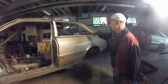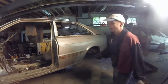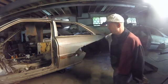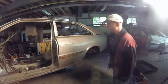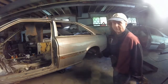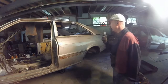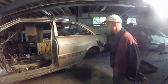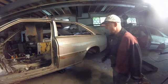So I'm just trying to figure out the least amount of places. Plus, we're going to cage the car. Seeing how we're going to cage the car, the outer structure is still very important for having the door pillar, the B pillar, stationary, and the A pillar completely welded to the front, and the C pillar welded to the actual arch. But we're going to give it extra bracing with the roll cage. On the Sport Quattro, I'm probably going to do a little bit more fiddling and a lot more bracing. So let me show you how to cut this thing off, and we'll go right on.